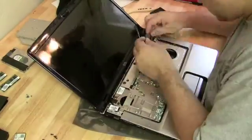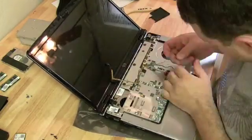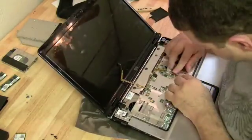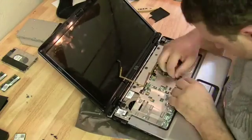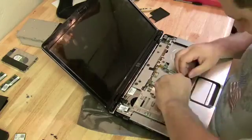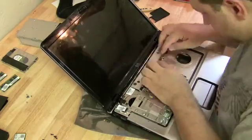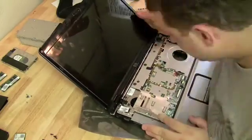Man, I wish I could really do laptop repairs this fast in real life. Okay, you got to feed those wireless antenna through the little gap that was created there under the keyboard. Same thing for the webcam cord here. Make sure everything's flush so the keyboard doesn't have any lumps when you put it back on. It all has to go back properly. It's all nice and even.